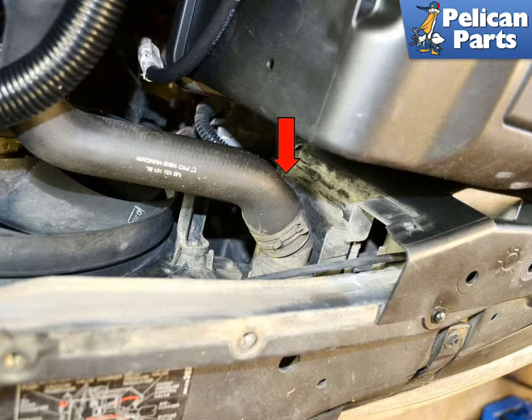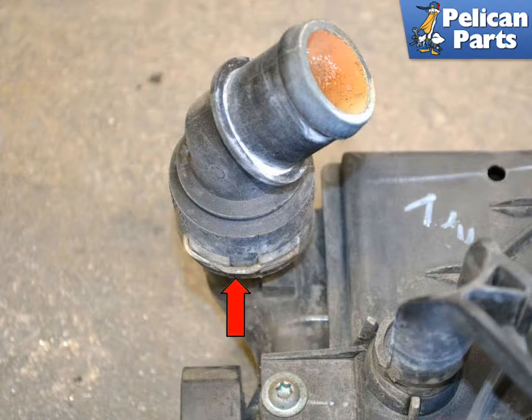The upper radiator hose is removed by releasing the traditional hose clamp (red arrow). With the radiator out of the car, you can get a better view of the quick disconnect coupler. If you are replacing the hose and coupler, you do not need to remove the radiator — just release the retaining spring (red arrow) and wiggle the coupler from the radiator. Use caution as these parts are plastic and have seen a lot of heat cycles, which can make them brittle.